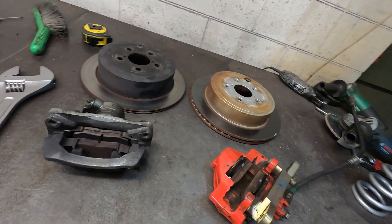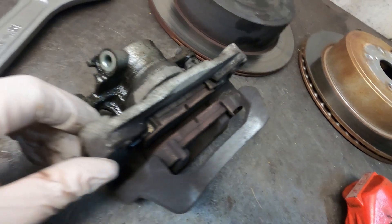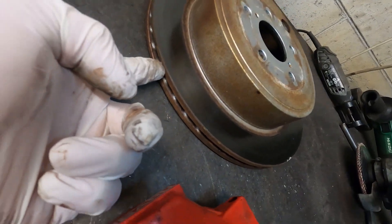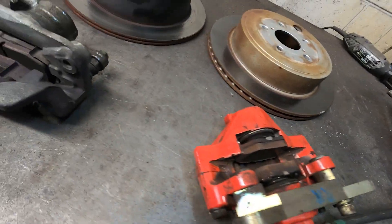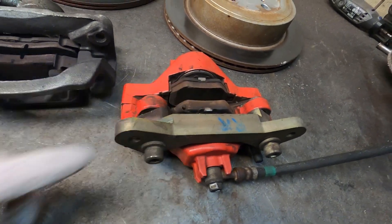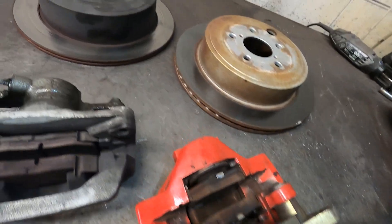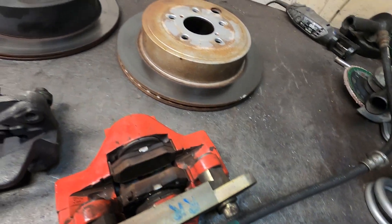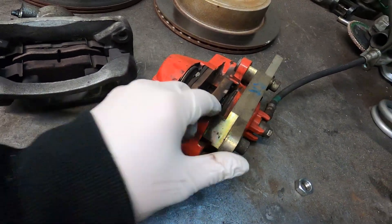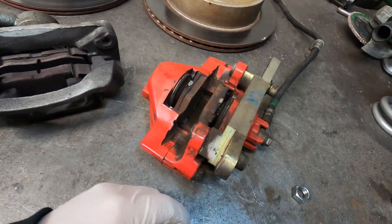This is a comparison between the old brakes and the new. The standard GT86 has got a solid rotor and a single pot caliper. I'm upgrading to a vented rotor and twin pot. Interestingly the pad in the twin pot is actually bigger than the one in the single pot. So hopefully I'm actually upgrading it rather than making it worse. These are just extra Subaru stuff so pads are pretty easy to get hold of. And obviously this caliper doesn't bolt straight on — it's got this adapter bracket which looks nicely machined.